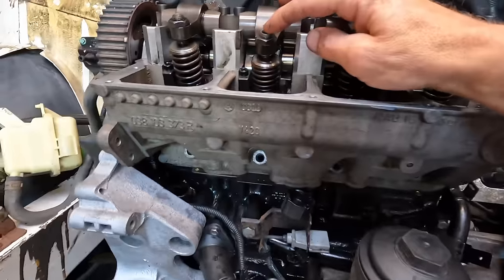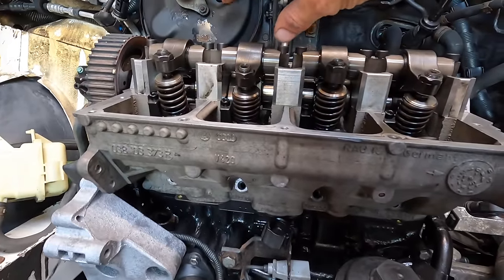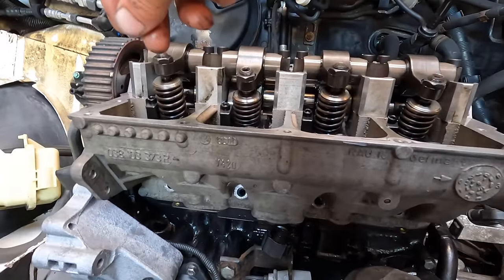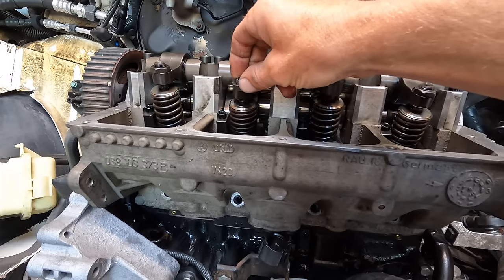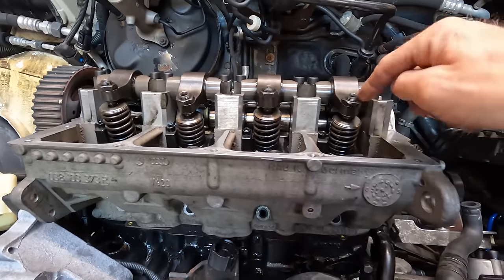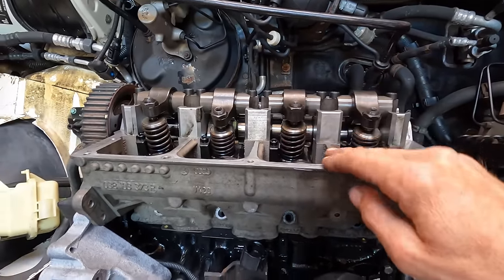You wind this 6mm hex bit all the way in till it stops. Literally, just as it stops, fa-donk. You then undo it 180 degrees whilst holding the ratchet or the 5mm, 6mm hex, and then you do this nut up, which is 18 to 25 foot-pounds. Keep rotating the head and do all four. That way, it won't sound tappy, it will sound really nice.